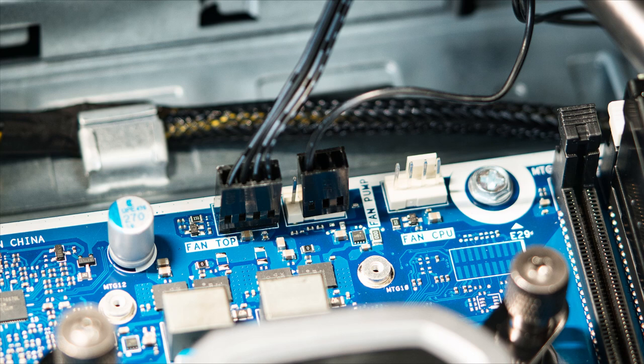For different OEMs or maybe models like the R9, I've read that you may have to switch the connection from the fan pump header to the fan CPU header to avoid BIOS errors. Some people on previous posts have been using a different — maybe version one — H60 pump, so leave a comment if this works for your version of Alienware.